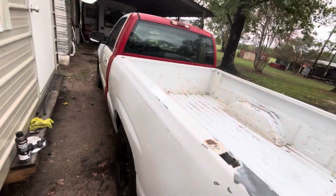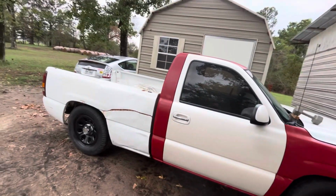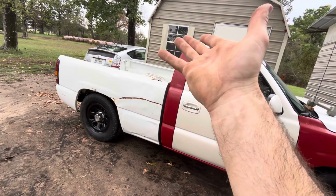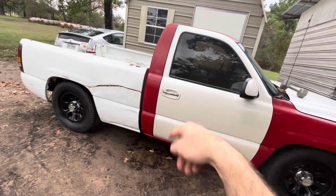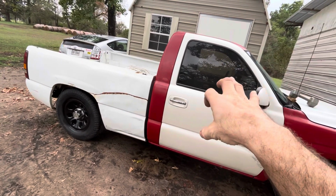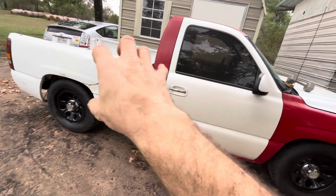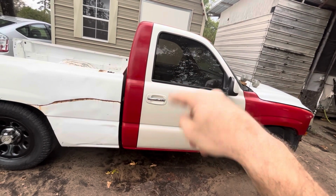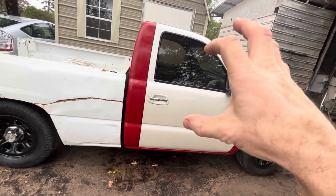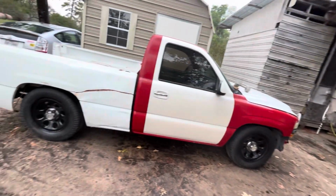Tail lights still look good. Everything still works, all the lights and stuff. It would probably drive just fine, but the things that are keeping me from driving it, well, obviously the fuel pump, but with that fuel pump, I could put gas in it and keep it above the sending unit. But the drive shaft length, I need to have that checked because it drips out the tail shaft. It doesn't drip from the seal on the tail shaft. It drips through the middle of the yoke, which I'm guessing is not sealed. I don't know why the middle of the yoke has a hole in it. I'm wondering if I could just get a solid yoke that doesn't have any hole in the back of it, and then it could just seal on the outer part of the tail shaft. But there's probably some reason that hole has to be there. But anyway, I think it needs to be lengthened like an inch.